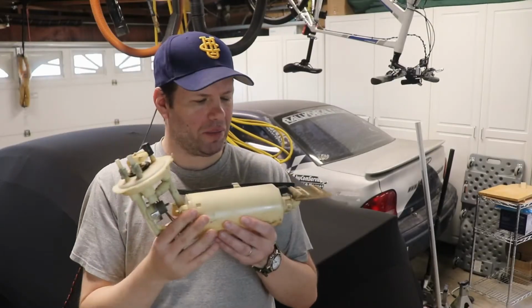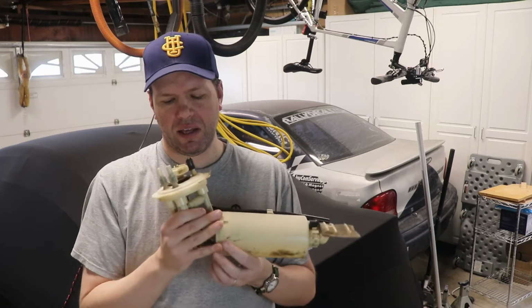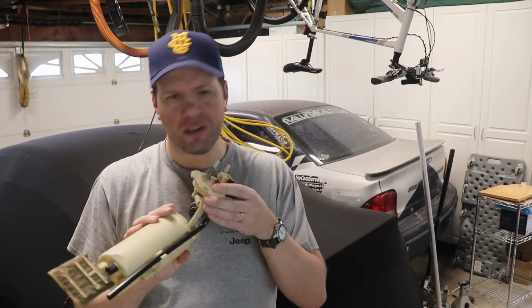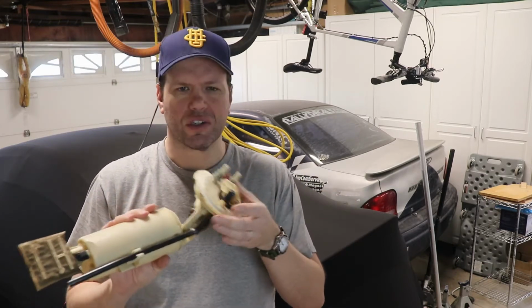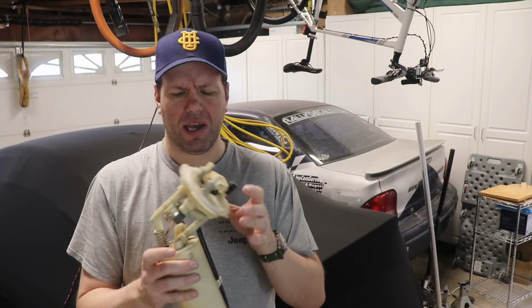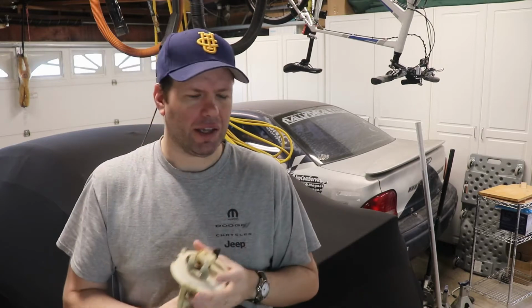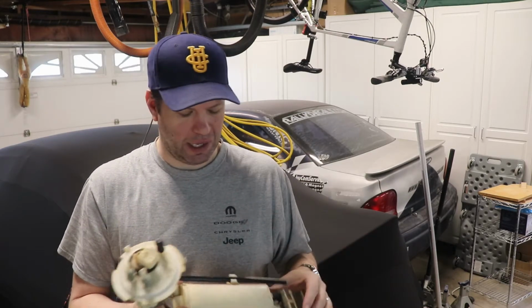So we had some questions about the fuel tank from episode 1. Okay, so we've got the baby. This is an old one out of an old car. And if you look, the newer models have a larger opening. The first gen to like '97, I think, had the smaller one. But the '98s got this big old, probably like 8-inch opening that you can get your hand in there and clean out any of the junk.